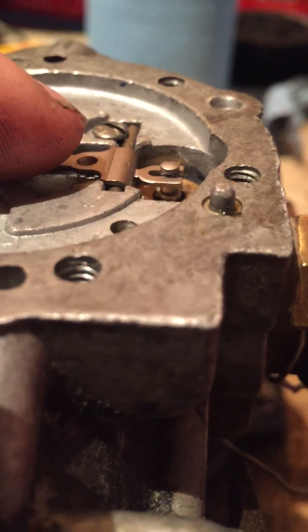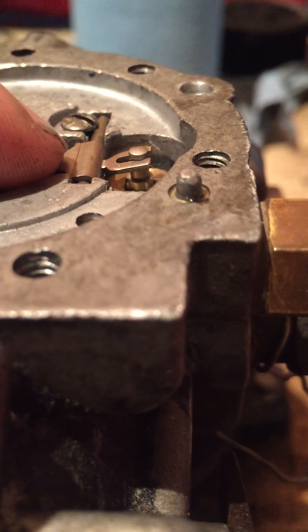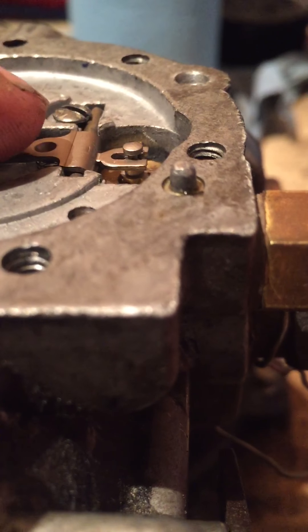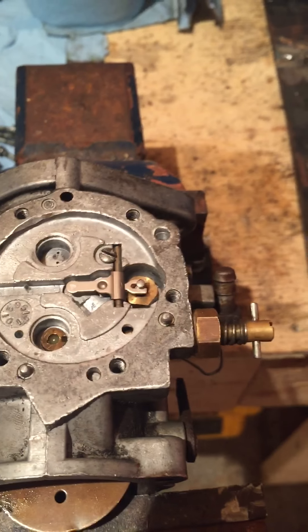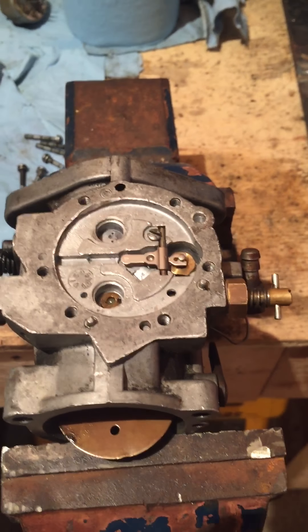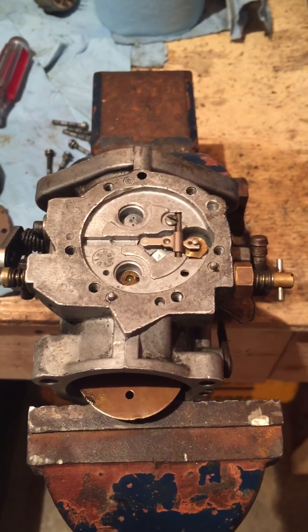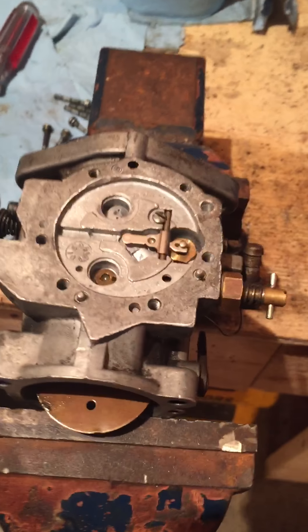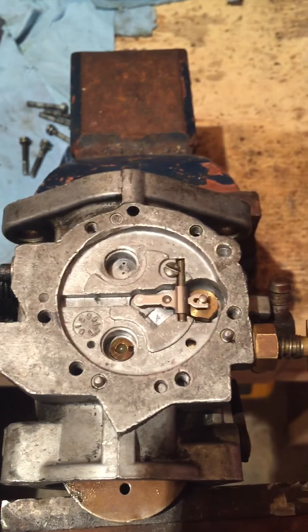The next thing I checked is for needle movement. See how there's a lot of play in that before it moves up - a lot of play. So I had to replace that. If you want, you can take out your needle and just look at the rubber tip, because they're some type of rubber, and see if it's starting to crack or missing half of it. If it is, replace it because it won't run right - it'll flood it every time.